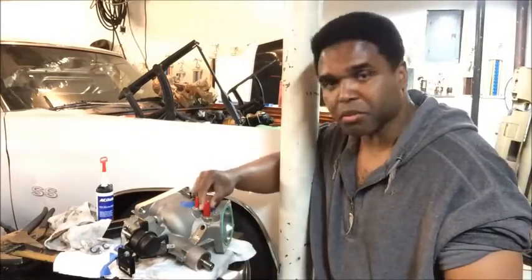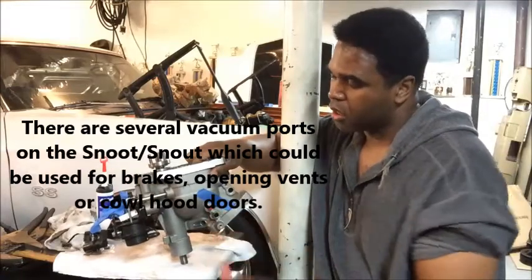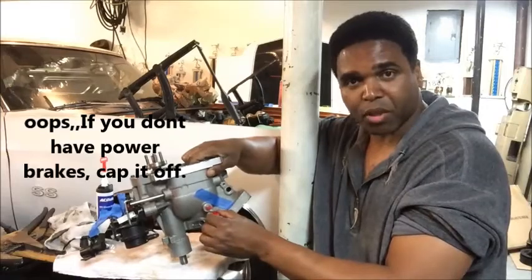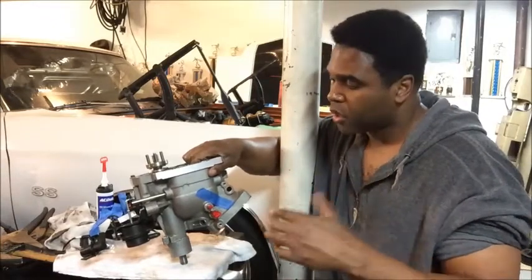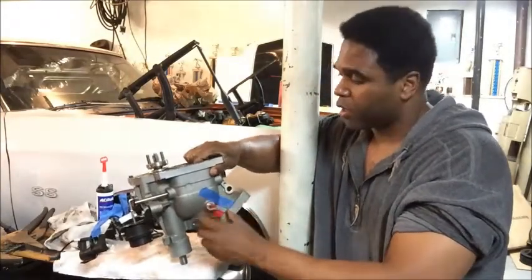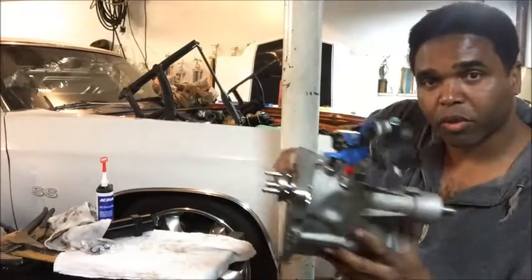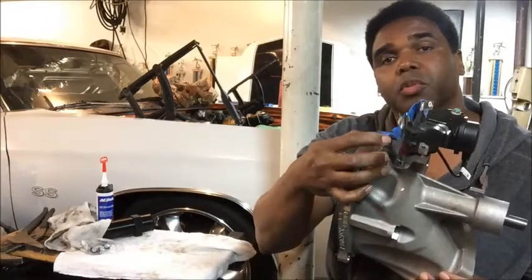I'm going to use these — these are the vacuum ports. The big one: if you have vacuum brakes, like a booster, you tie the brake booster to the big opening right here. If you don't have brakes or you don't need vacuum, just cap it off. This small one — on my Chevelle it uses vacuum to open up the doors for the heat and the vent doors. Some cars have vacuum actuators which you need to have the car work, but if your car is set up just for racing, you're not going to need it, so just cap it off.